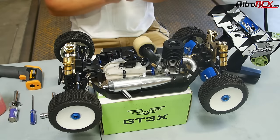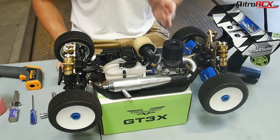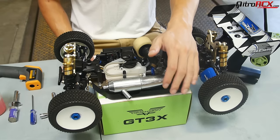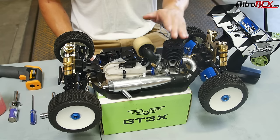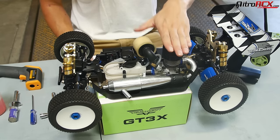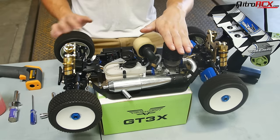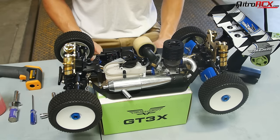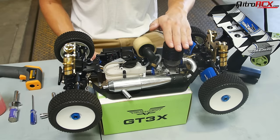Moving off the concept of the ideal mixture of air and fuel, you want this engine to run on the ideal mixture so it gets the most performance. If you run leaner, that gives you more power, however your engine temperatures go higher. You reach a certain temperature where it's too hot and you start damaging the motor or shortening the lifespan. We have the temperature range in the break-in video — refer to that — and you definitely want to stay within that range.